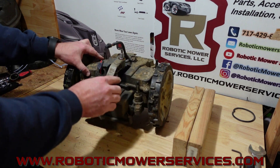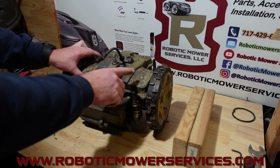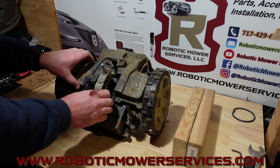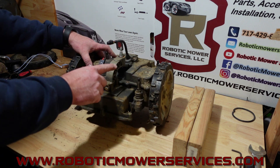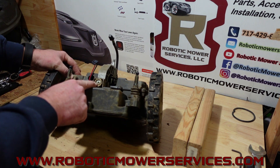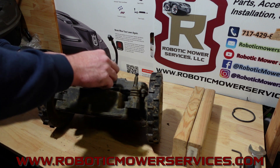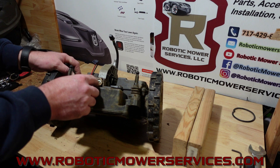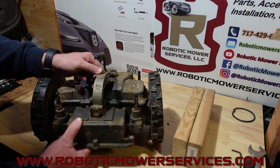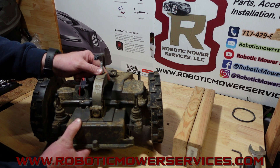Now you're down to your chassis and you have your arm here. You can't take this part off without getting this out of the way — it just won't lift up and slide past. So you have to take this arm out. In order to do that there's a screw right here that takes a 4mm Allen wrench, and it can be a little tight because everything kind of rusts and corrodes in there. You can see this arm has a lot of wear on it — it'll flop front to back, and that front-to-back movement is starting to wear on this one.